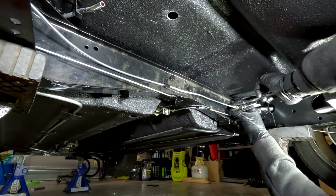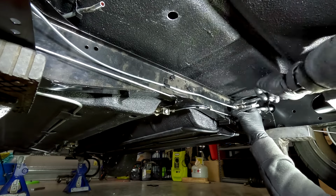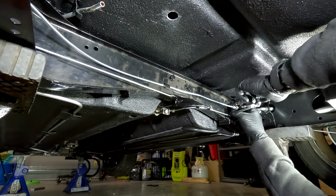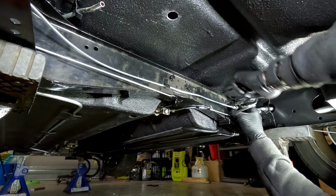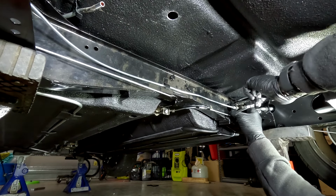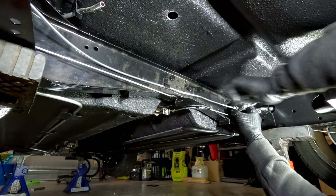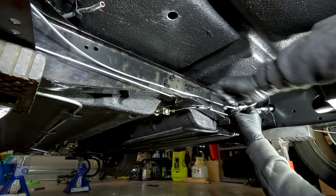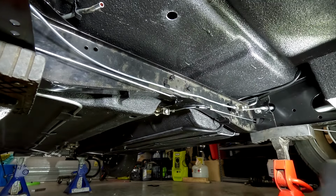Now, it is also worthwhile noting that when you are doing up brake lines, it may sound really dumb, and you're probably thinking at home, why do you even need to say that? Do not over-tighten brake hoses, otherwise you will strip them and crush the ends of them, because they are made and designed to fit in, for instance, like a male and a female joint. If you over-tighten it, you're going to crush it, you're going to mushroom it, it's going to leak, and the last thing you want is a leak on something like a fuel or a brake system, impairing the drivability of the vehicle.